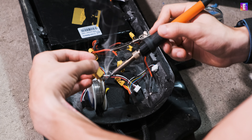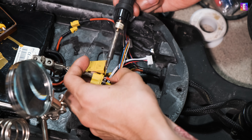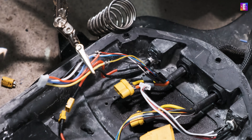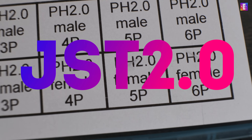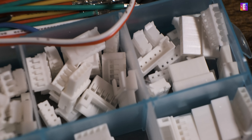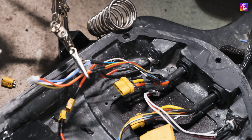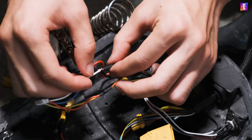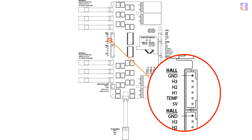I need to swap out the connectors for the battery and motors. I also swap out the motor sensor wire because the Tenka — and any VESC for that matter — uses 6-pin JST connectors, which you can find easily on Amazon. If you have a soldering iron, it's really not that hard to reconnect the wires. Since the Tenka uses a 6-pin instead of the 5-pin of the Hobbywing ESC, I had to reorient the connections using a schematic.